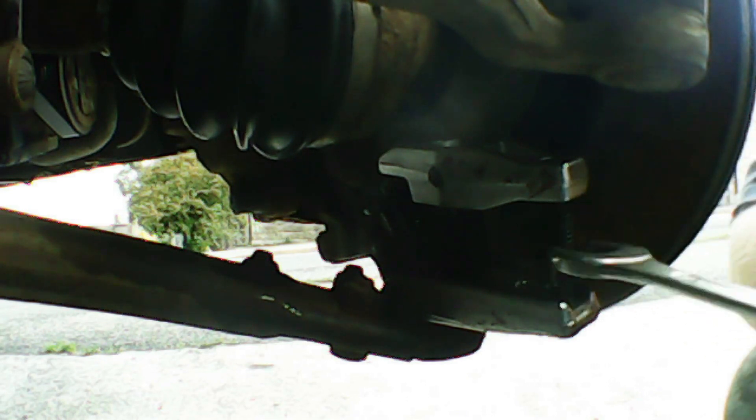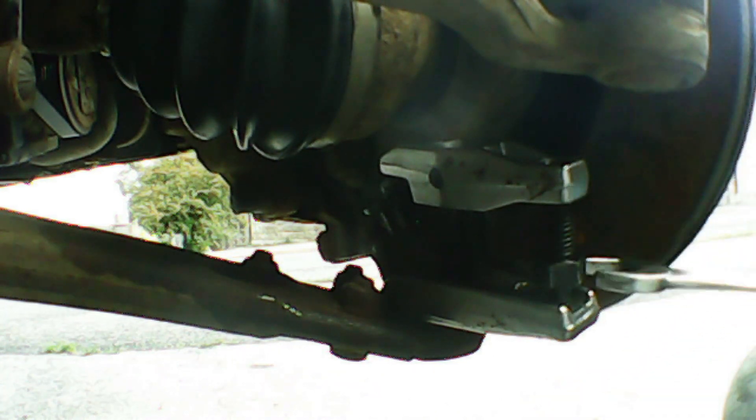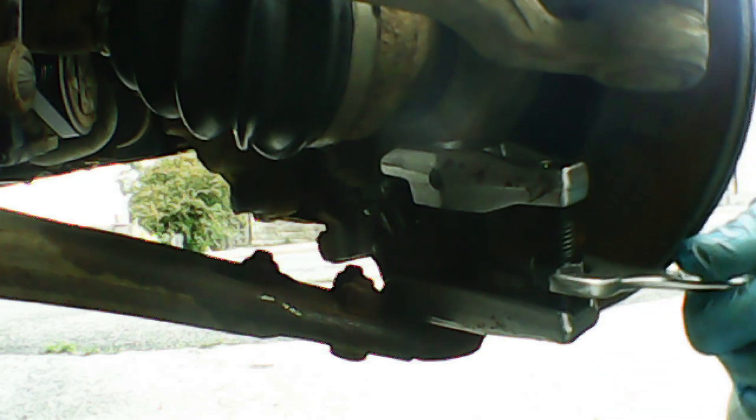So here's the ball joint tool in action. I haven't got any footage of the other tool — I do have a tie rod to do — but this ball joint here I'm just using my 19mm spanner to work it out. You can also use a ratcheting spanner; it does make it a bit quicker. All you have to do is just work the 19mm fastener around and as you do so it puts pressure on the end of the ball joint tool and that'll pop it out. It's a nice satisfying pop.